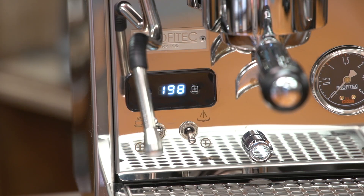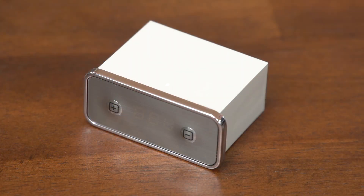The third and most precise way of controlling temperature inside an espresso machine is a PID — a PID is essentially a digital thermostat. The way it works is very much like the cruise control in your car, meaning a car can add gas but it doesn't brake. The PID is the same thing: it turns the heating element on and off, but it doesn't cool the water in any way. It has an algorithm that calculates your set point, and it turns that element on and off several hundred times a minute to achieve a set temperature.